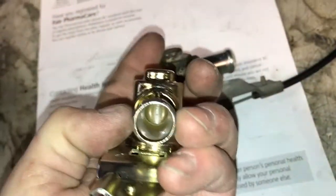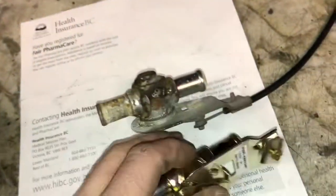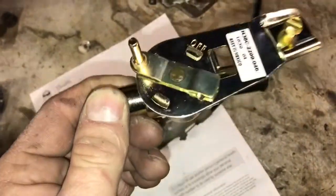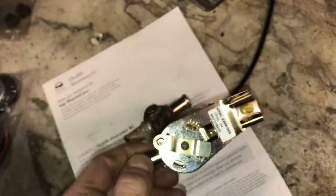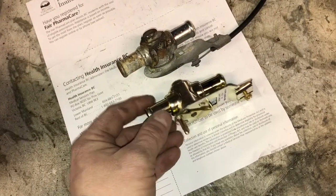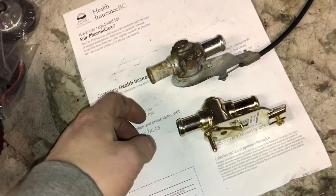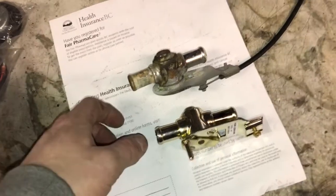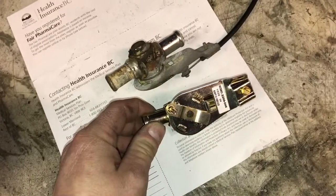Things are coming together. There is absolutely no sense in not replacing this. If you have a Milan and you're under the dash, you've got to replace this if you can find one, because it is such a bitch to do after the fact. And not only that, if this valve fails in a bad way, or any of the hoses attached to it going in or out of the core, you're going to end up with a real burnt foot. So it's definitely recommended to spend — I think this valve is about $38. Definitely worth not scalding your feet for $38.